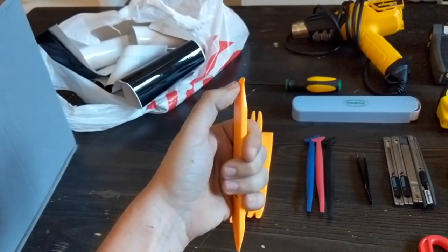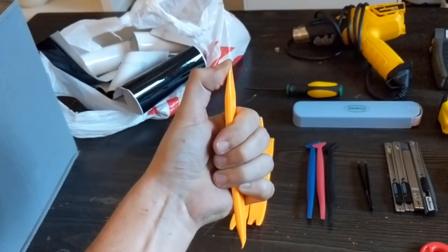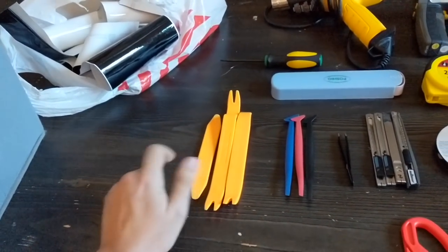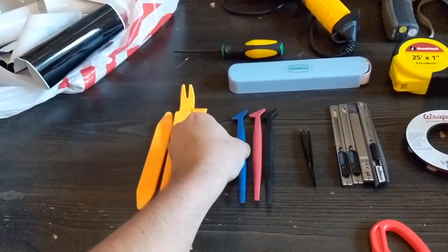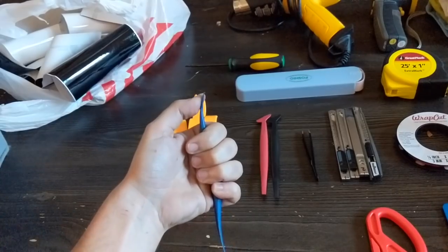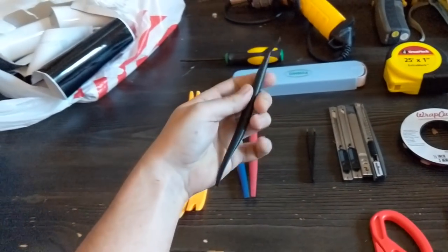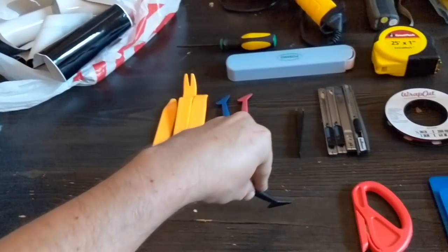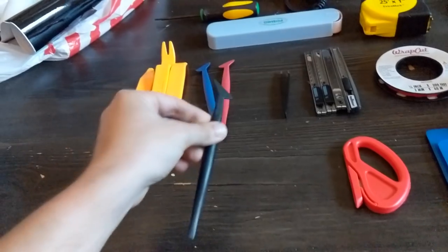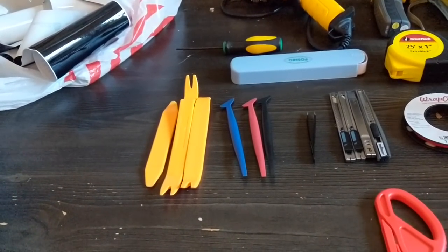Be a little careful when using these near heat because it will deform the very tip. Without heat they're very hard and durable, but with heat you kind of ruin the edge. Definitely a must-have for interior stuff. These tucking tools are awesome — there are three different ones. The least firm one, a middle one, and then the black hard plastic. The black one, if used incorrectly trying to push vinyl into a gap, will cut the vinyl. So I didn't use that one very much — mostly the middle one, which was a good halfway between getting it in the crease without cutting the film. Super useful. A really nice pair of tweezers is also super helpful, especially when doing the emblems.